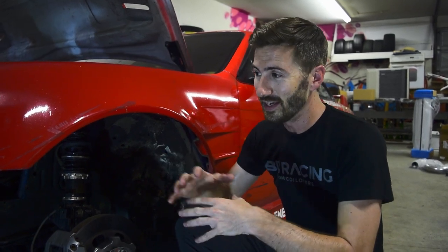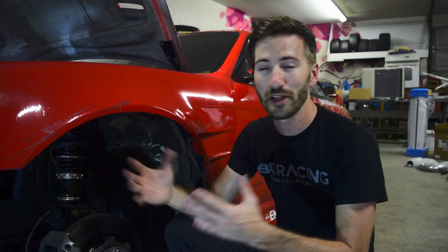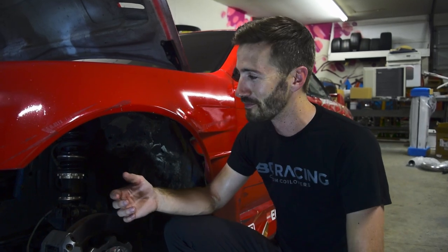So, you know, the spring rate is kind of arbitrary in terms of just a number. It's more about the balance, front to rear, okay? It's all about balance. You've heard me talk about that before. So the rear spring rate I run is currently a 6K. I could even go down to a 5K or a 4K if I wanted to, but depending on your setup, the type of tires you run, and your driving style, you may or may not want to do that.